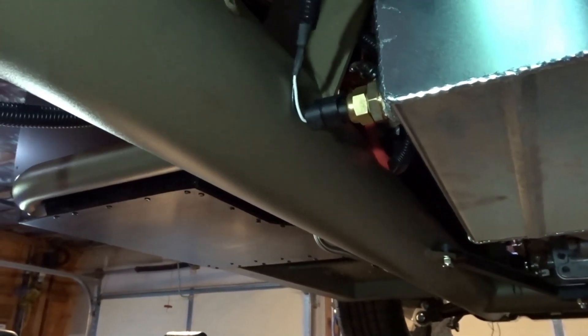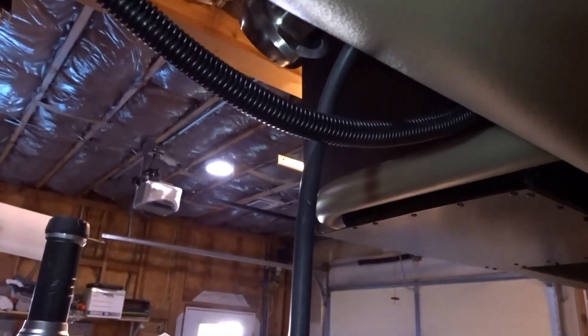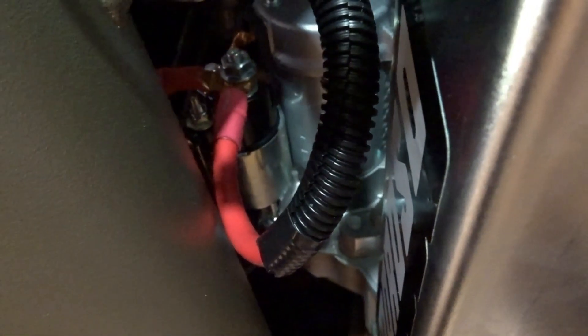Next day — I am working underneath the car getting all of the battery cables in place. Right here on our ground stud, I've got our main battery ground that's going to go to our battery hanging down right here. The one with the split loom on it is our positive, and it's going over to the starter. It's not in its final spot right now — I'm going to make it a little neater, but I did need this loop on it to keep it away from anything it might come in contact with. It'll be pulled back away from the oil pan and run down the 4-inch tube where it's going to meet up with the ground cable. Those are going to go forward together. I do have the battery in place and it is tied down — just snug. Don't over-tighten them; you put too much pressure on them and you're going to crack the plastic case and it'll leak. Let me lower the car down and I'll give you a peek on top to show you where we're going to strap those cables.